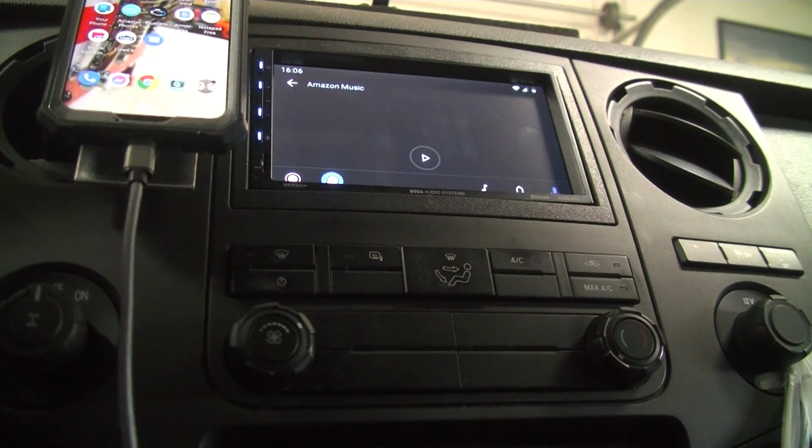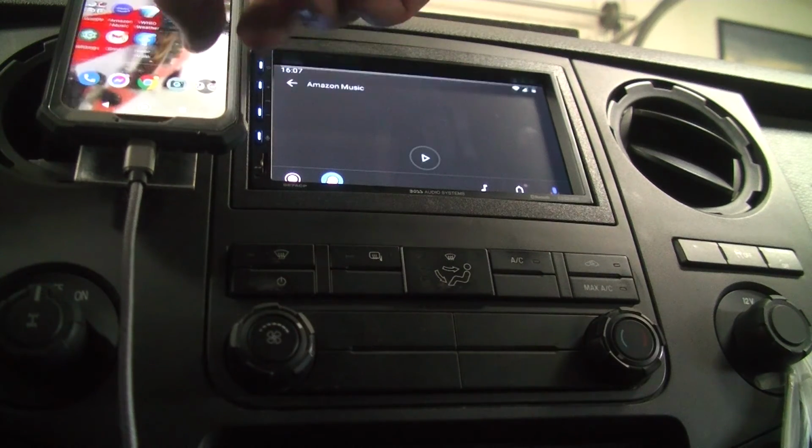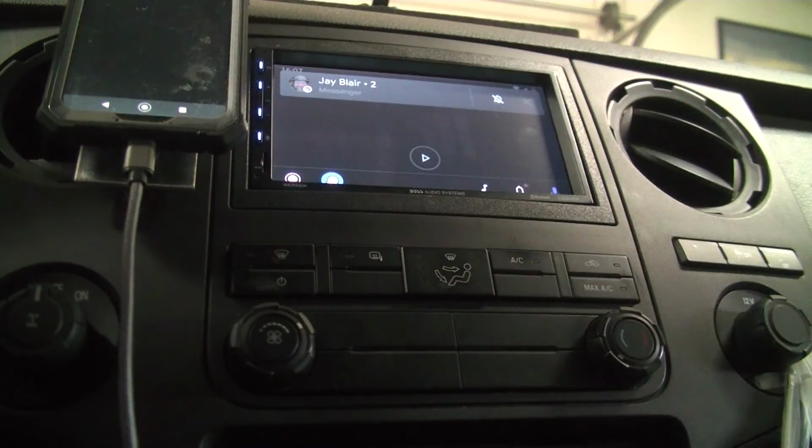So all right, it's been an eventful couple of days. We put the new deck in. We also put a rear view camera in, ran the wiring loom to the tail light for trigger power, because this harness has a smart something, it knows that it's in reverse, but then we supplied power from when the rear light comes on, and so there we are.